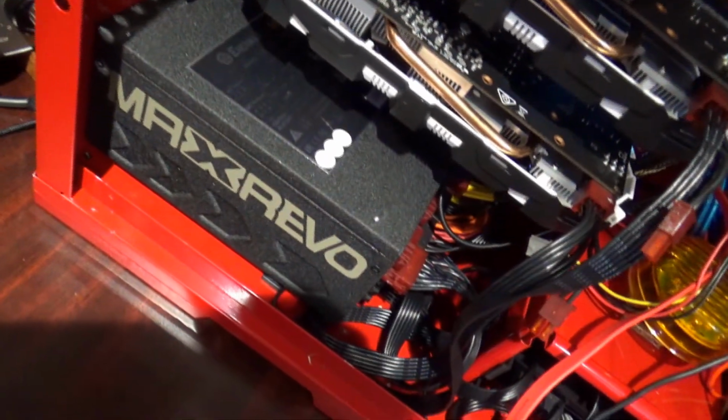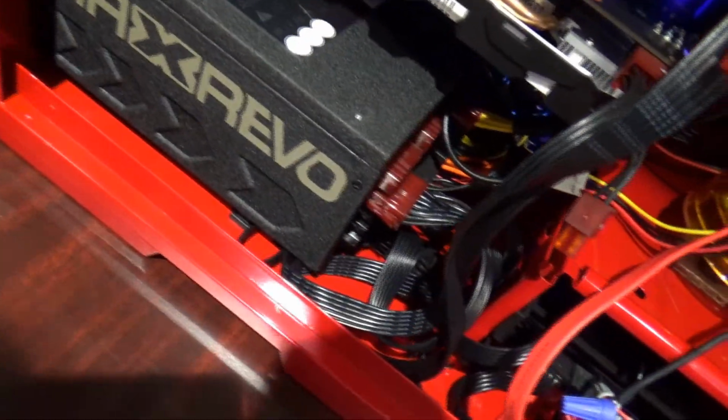But anyway, so I installed the power supply, and then I went through the little owner's manual, making sure I had the right cables plugged into the right sockets. You've got separate sockets for the motherboard, and then others for peripherals and other things that take power. So like the red ones are for peripherals like the video cards, and the black ones way down the bottom are plugged in. Those are for hard drives, CD-ROMs, fans if any, or whichever. And the top red ones you can't really see. That's all for the power supply stuff.